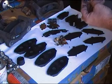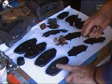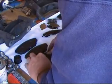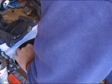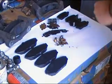We're going to squeeze out a little bit of this, and on the back of each brake pad, we're going to do the fronts first. We're going to just take your finger, rub on some of this brake grease all the way across the surface. They just snap right into place, just like that, for the front pads. So we're going to get all these on here. Okay, those are all snapped into place. So there's a coat of lubricant between the pad and the shim.